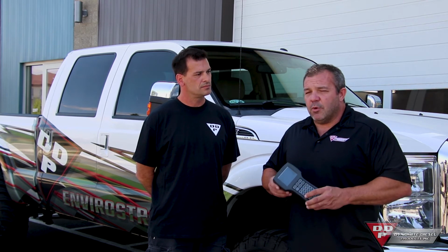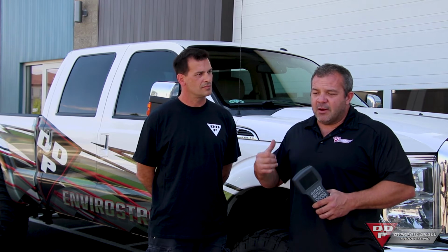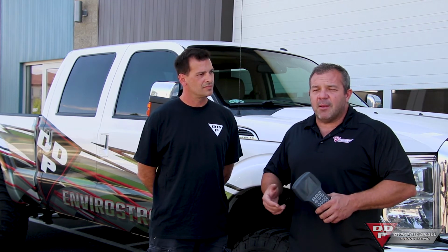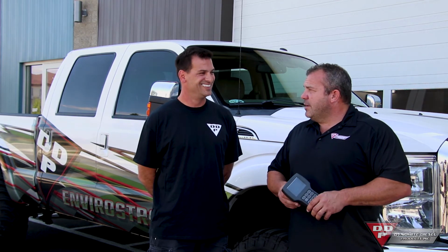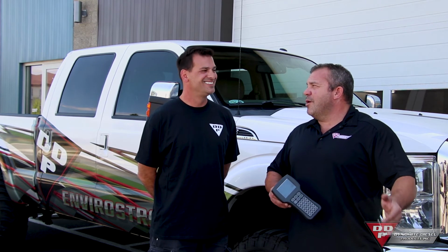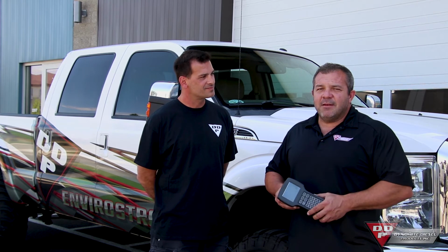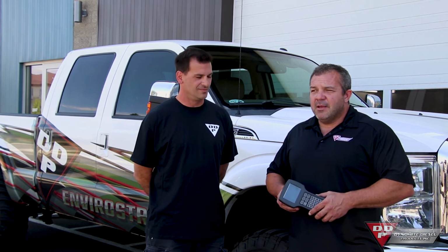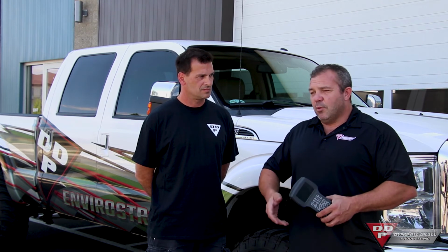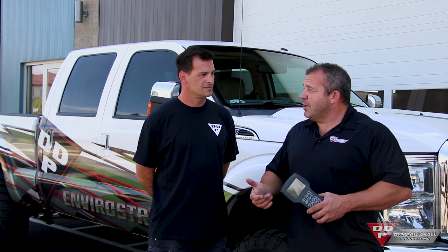Being at the dyno shop, we'll end up using this thing, and it's kind of our daily operation. We basically come in, we strap the truck down, we dyno it. We get a baseline, we take the injectors back out, run them in the injector shop, modify injectors, try and do a little more grinding, a little less grinding, a little more extrude hone, a little less extrude hone, run the injectors back here, dyno it again, check the opacity again. If we're heading in the right direction on the power and we're heading in the right direction on the opacity, we'll tear them back out, then repeat the process. There is a lot of work involved.